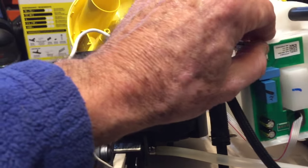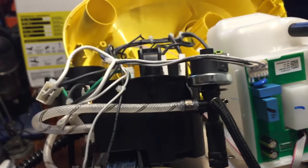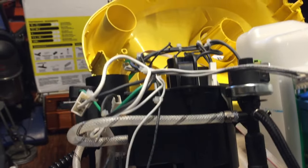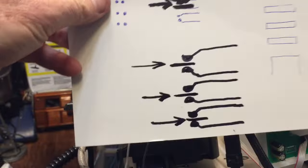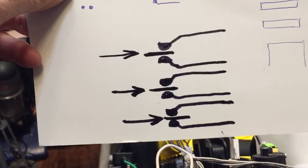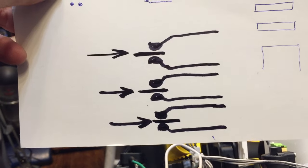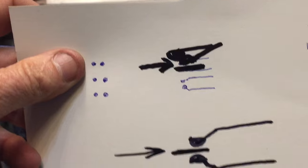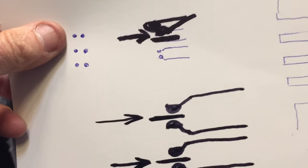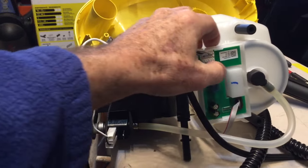As I began looking things over quite carefully, I noticed that this connector here wasn't put on correctly — actually, it was crushing one of the connectors. The contact points that would have to make contact weren't doing so. What had happened is one of them got crushed, so it wasn't making good firm contact. Their quality control failed to catch it.